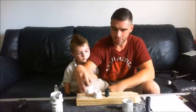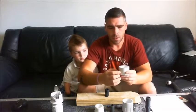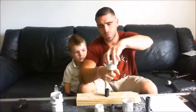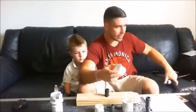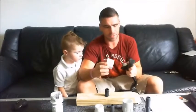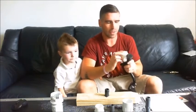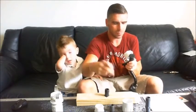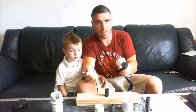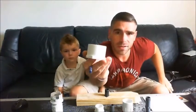What we have to do before we put this together is get a measurement of how wide the handlebar itself is, because we need to cut a groove so it will sit flush on the handlebar. I took the handlebar and did it on the grip part because it's less likely to slide and move around. I just held it up to the handlebar and marked on that side and then on that side and then back here, so you can see a couple marks there.